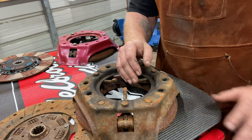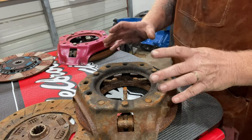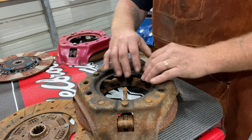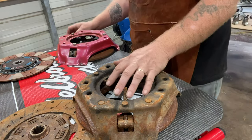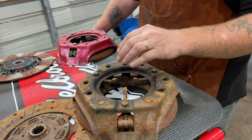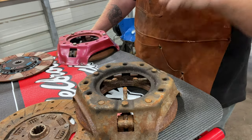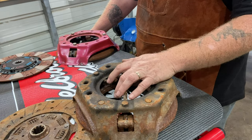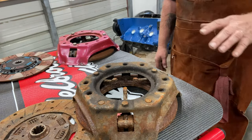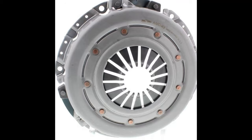I don't really ever use a diaphragm style. In stock form right out of the box, you will see more of the three-finger style in trucks and more of the diaphragm style in cars. The very basics of it is that these three-finger units have more clamping force - if you like towing a load, it clamps harder. But especially in an older vehicle that has the metal Z-bar rather than hydraulics, they take more foot pressure to work. They use the diaphragm more or less for comfort. I do prefer these because they have a little more clamping force. I'll find a picture and insert a diaphragm style right here so you've got a comparison of the two.